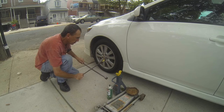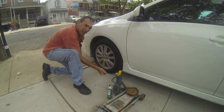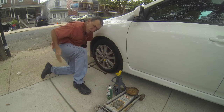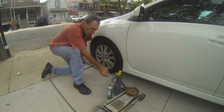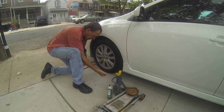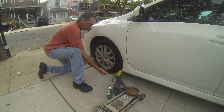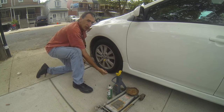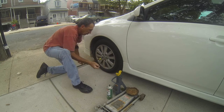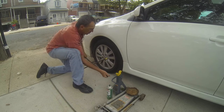You need a cross wrench and you just can't unloosen these things. See how tight they are? If you don't have the strength, you've got this foot here that gives you the strength. Don't just put your hand underneath because you'll hit the bottom and scrape your knuckles. Use your weight and your whole body, and the lug nut will come off. Same thing for the next one and the next one.